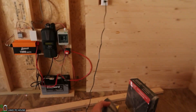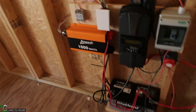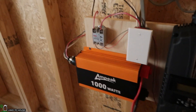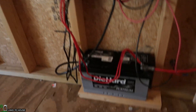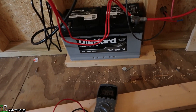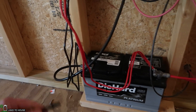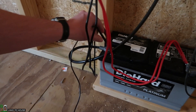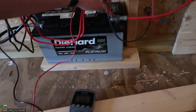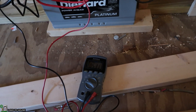I've got my multimeter here. The Ampeak has an auto shut off somewhere around the 10 volt range if I remember right. So hopefully we'll be able to just touch the battery with this and see what we've got. Yikes — five volts. Alright, so there's our problem.